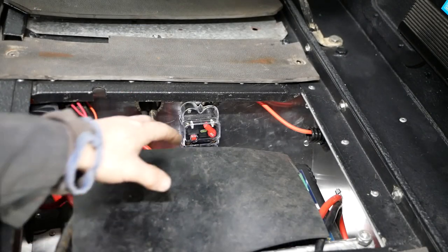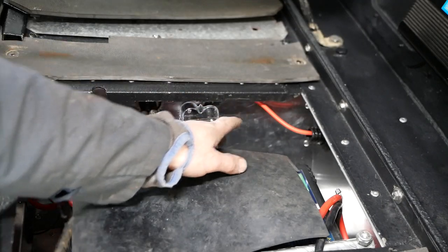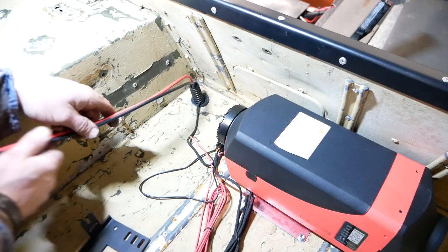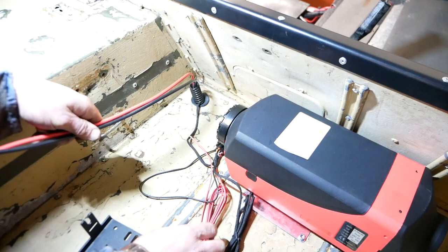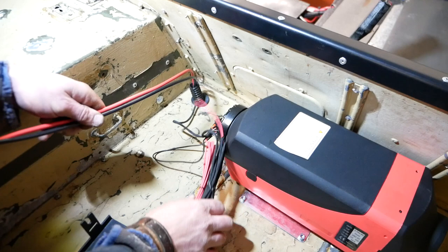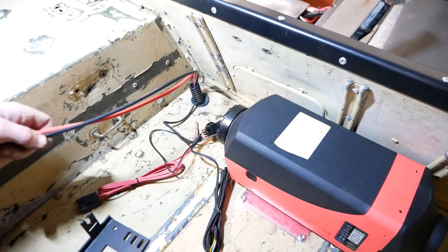That's all in now — wiring is slow going. I've brought a single live off it and the earth runs to a factory earth underneath. My two cables are coming up from the battery — they're way too long, about four meters too long, but I ordered extra just in case. My diesel heater's in by the way, fastened in place — that's the wiring for the diesel heater. I'm going to take the power supply from this control unit to run the diesel heater.